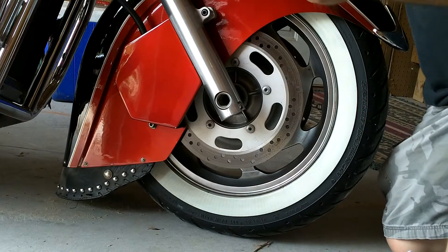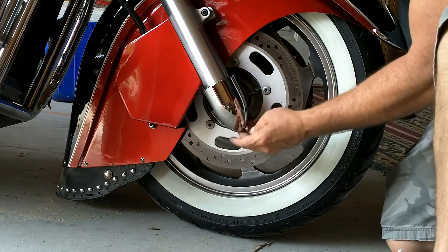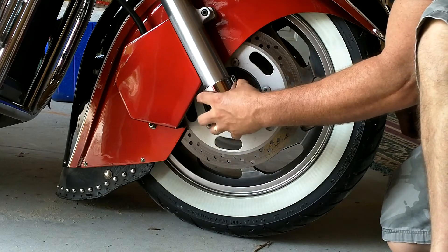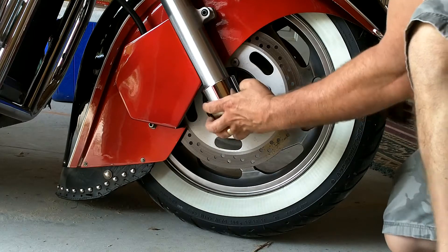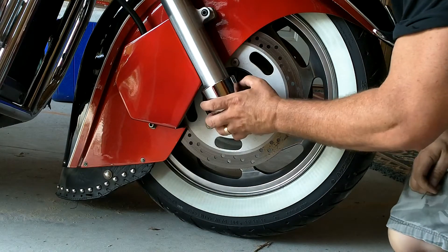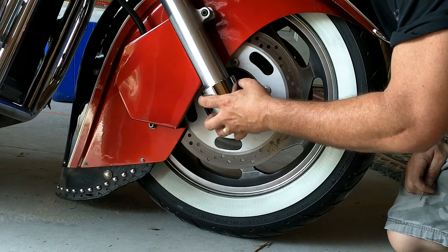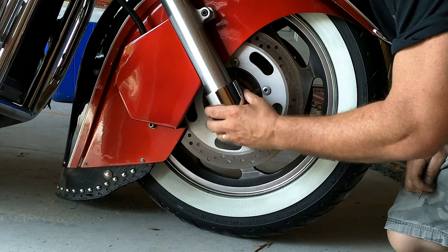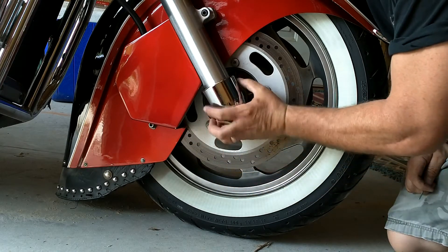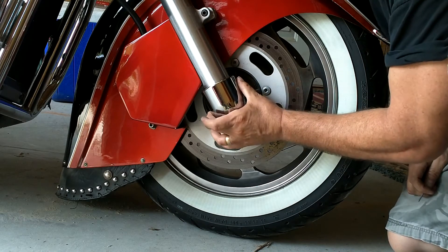I'm going to put these chrome billets on. First thing you got to do is replace your bolts here because they won't slide on. All you got to do is slide this on here and then there's two retention screws right there that you just screw in and keeps it from falling. What I'm going to do is make a little mark and then just drill into it just very shallow, so I got a little nub in there for these retention screws to hang on to — because I'm just afraid that the vibration is going to slide off and then you got essentially an $80 piece of billet aluminum bouncing down the road. So I'm going to mark these, drill it, and then put the set screws in. Should be good. The whole process is probably five minutes. Pretty easy.